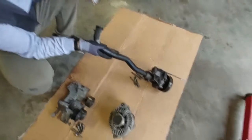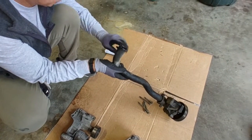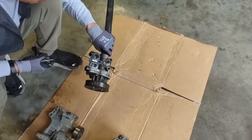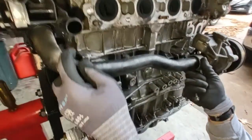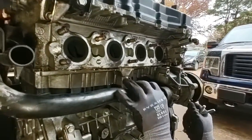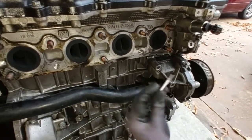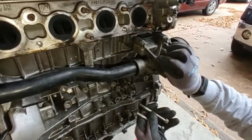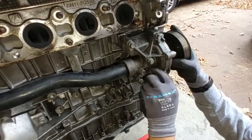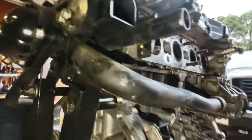Here's your water pump with the water pump pipe. We'll put a coating of dielectric grease on the O-ring. This is a gasket — you may want to consider replacing it. This coolant pipe fits into this opening over here and slides right in. Then the water pump mounts into the block. I'm using the shortest bolts first; the remaining three bolts are all the same length. Now that everything's connected — the water pump with the pipe to the coolant manifold — we'll torque everything down.